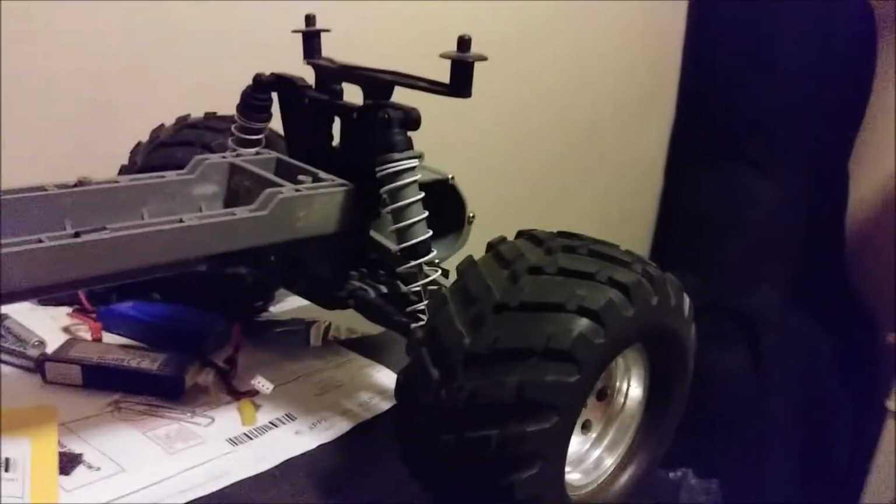Now I've got the hinge pins ordered, and I got the Savage shock parts, which you can barely see right there. That's a stock one. I'm going with a Savage one, and probably put the Savage, maybe the Savage shock ends on there. That way I could still run it in the most outer hole there on the A-arm. Have sufficient, really good handling.